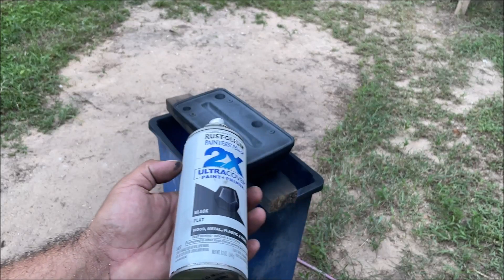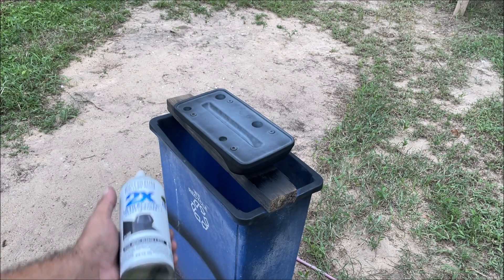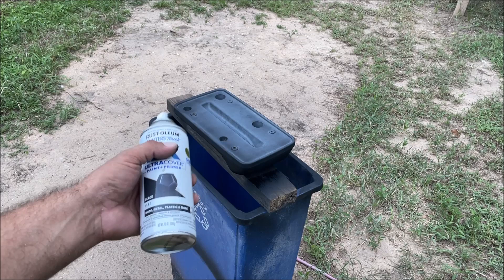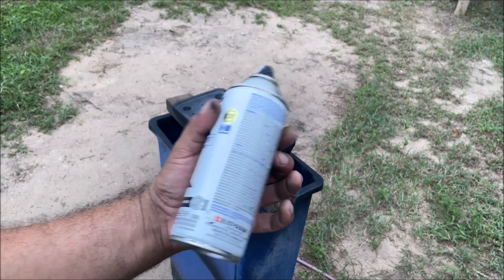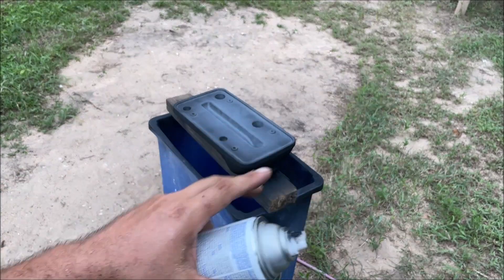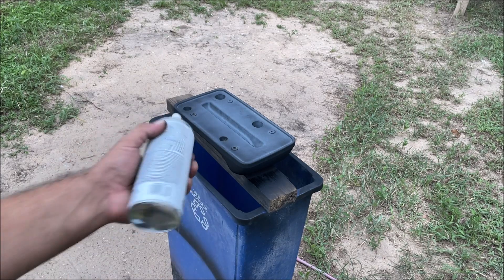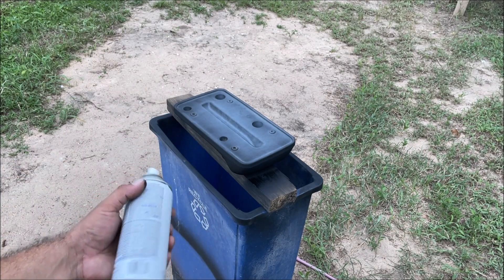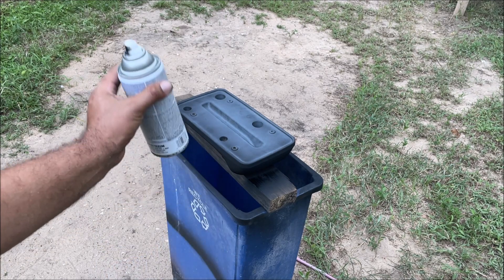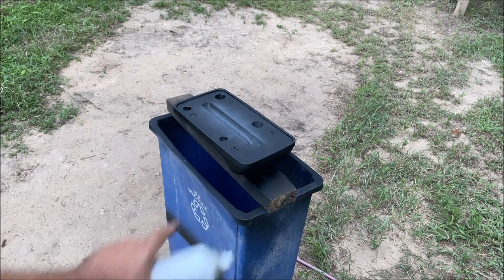In all my rattle can videos people say you need to use an adhesion promoter — well, use one if you feel like you need to. I don't, because I've never had my paint jobs flake off, peel off, or rub off. What I did differently is sandblast — I know the surface is clean without using a bunch of specialty cleaners or adhesion promoter gel. Adhesion promoter gets spread around the internet by people excited about shop products. If you're doing this for a customer and charging money, you'd want to use one, but this is for me on my Jeep and I promise you this stuff is not going to flake or fade off. We've got about three light coats on there, so we're going to let it dry and put it back on the Jeep.